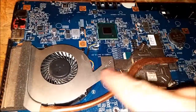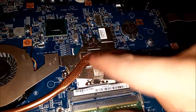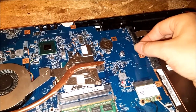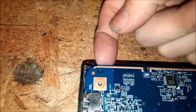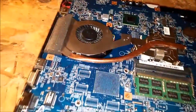You can take the heat sink along with the motherboard if you want. But if not, you can simply pull this up — there are three screws holding the heat sink on. After you get all that off, there is a connection underneath that you can't get to. So you're going to have to pull up right here and wiggle this out to the right. There will be a little dowel pin right here that you'll have to get your finger in and lift up off of it, while trying to overcome the connections here as well. It's kind of tricky, but it will come right out.